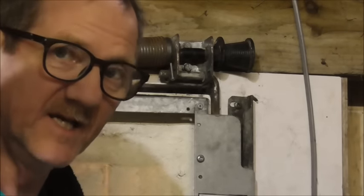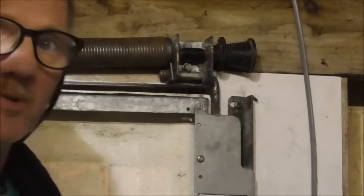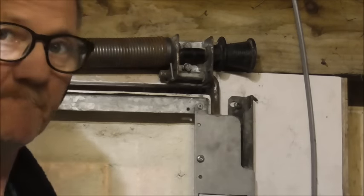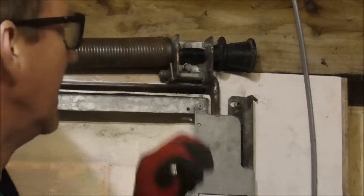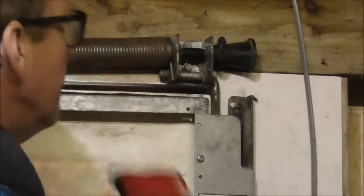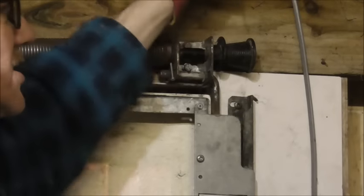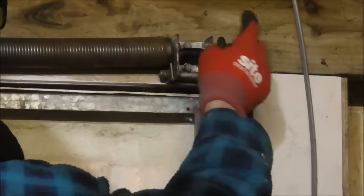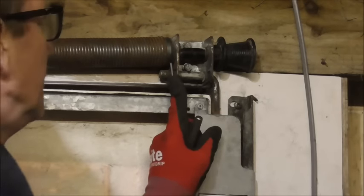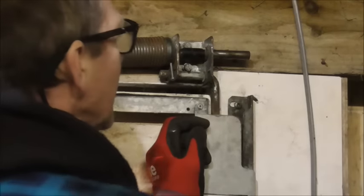It's difficult. A spanner on there won't do — it'll just go. I put a set of mole grips on; it grips it better, and that can act as an anchor when you pull one out and get the other one in. But you've got to go beyond one turn — you've got to go virtually another full turn to get it off. Once you've done it, you can get your pin in, which you must get that pin in before you take this off.